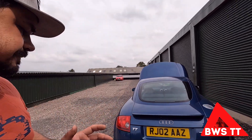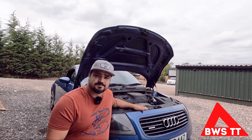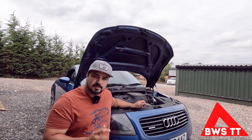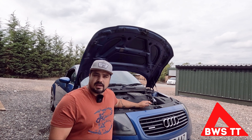Taking it for a spirited drive on the way back, it's clear the suspension is going to need some work. We've got this full exhaust system — it's a sports cat so it's going to flow nicely. Temperatures inside here are going to be an issue. Even after just two or three minutes of absolute flat-out driving on some country roads, coolant temperatures were creeping high into the 90s. Oil temps I wasn't monitoring but you can guarantee those are up there as well. So we need to sort out cooling and we need to do it on the cheap.